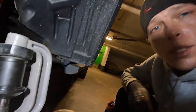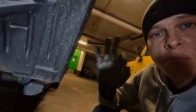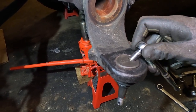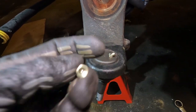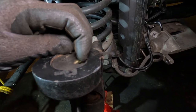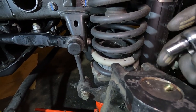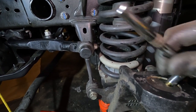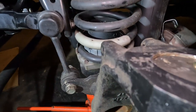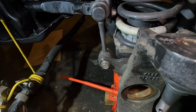Not bad — it seats them really nice. Taking them out there's a little bit of playing around to get it seated properly to get the cup to sit, but to get them back in, no problem. Be careful with these guys because I already broke one — that's why I'm going to have to use one of the flush mount ones, because I snapped one of my regular ones. I was able to extract it and put in another one, but we're gonna have to use one of these weird flush guys. To be honest I have a hard enough time getting grease into a normal one, so this one is definitely going to be interesting. You can see the thing looks like a bolt but it does have a little inlet right there, so we'll see if I can even get grease in that thing.